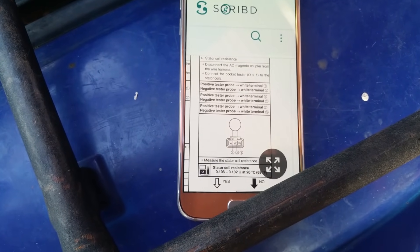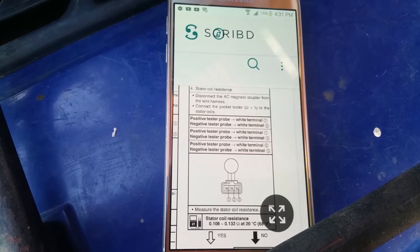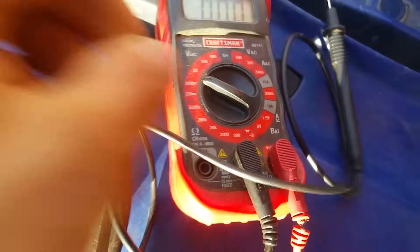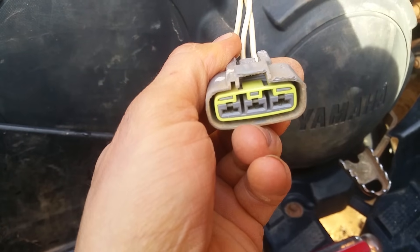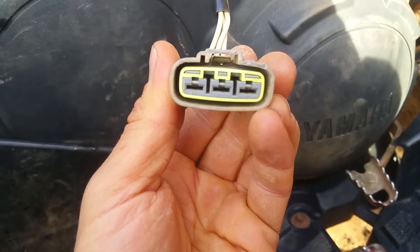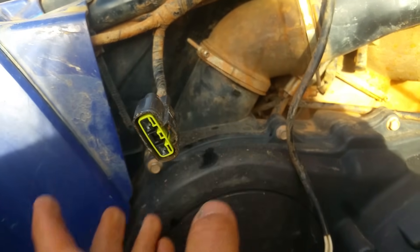In order to check the stator, you gotta measure the coil resistance — you can see 0.10 ohms, and our multimeter doesn't go down that low, and yours probably doesn't either. So we're gonna do quick and dirty: you can see positive to one wire, negative to another, and test all combinations with the multimeter. We've got the multimeter set to AC voltage, and we're gonna probe these wires with the thing running to see what kind of voltage we get to make sure the stator's working. There's probably ranges of voltage it's supposed to be in the service manual, but we couldn't find that online. There was also a little bit of corrosion down in the connector, and that wasn't helping — we're gonna clean that out and put some dielectric grease to keep the corrosion at bay.